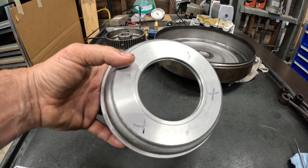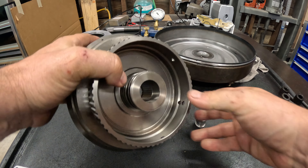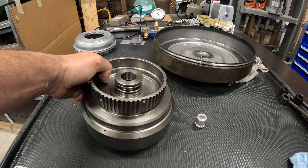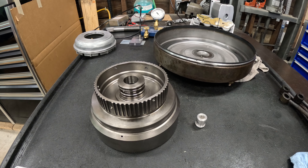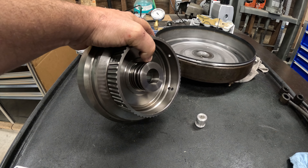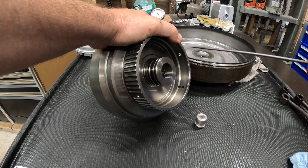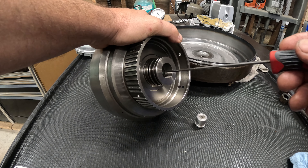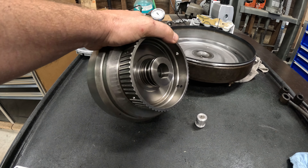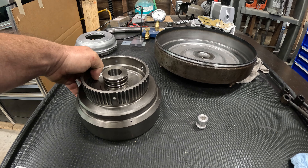Next is a stripped forward drum. You can see inside here — this is the partial splined version. This is usually accompanied by a blown out center shaft roller or ball bearing, but not always. The difference is the center shaft engages in this direction. I really don't understand why Ford stopped doing this — the extra length of splines would absolutely engage the center shaft and offer more than 50% more spline engagement.